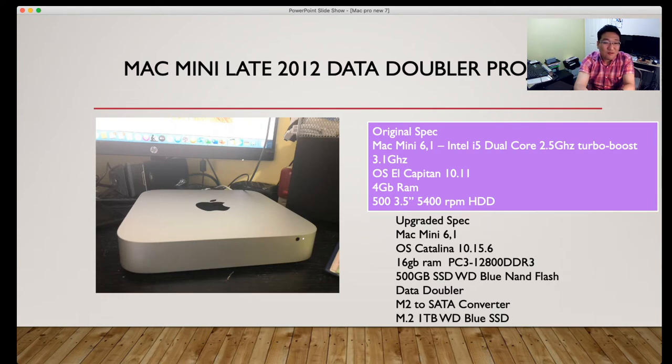You can have two SSDs — one for Windows 10 and one for macOS Catalina. If you are considering upgrading to macOS Big Sur, which was released in November this year, officially this is an unsupported Mac so you are not able to upgrade to Big Sur. However, if you want to do it, you can use OpenCore — just be aware that Wi-Fi and Bluetooth will not work. You can either buy new supported hardware, or use OpenCore with a custom configuration.